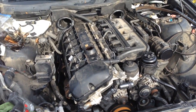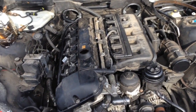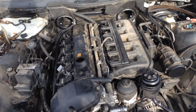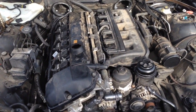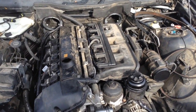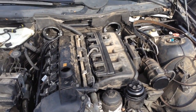So we have a no start situation we had before I took it apart. I tested the starter. The starter was bad. That's pretty common on these. They won't start, and people just keep cranking and cranking until it blows the starter up. Took it off, hooked power to it. It would not do anything. It was just dead in the water. Smelled like burnt wires, just gone, right?